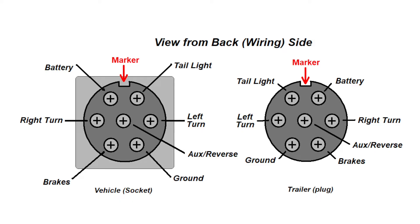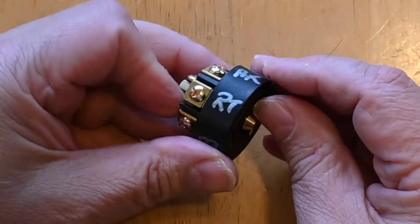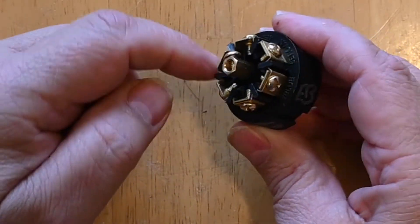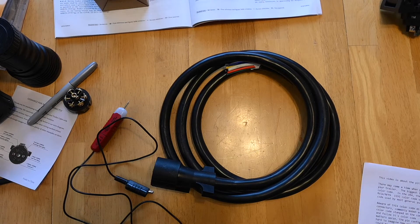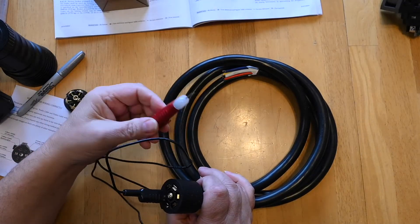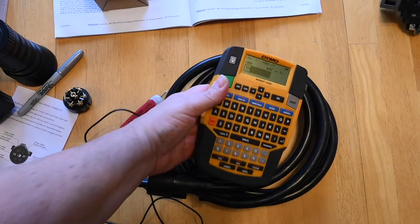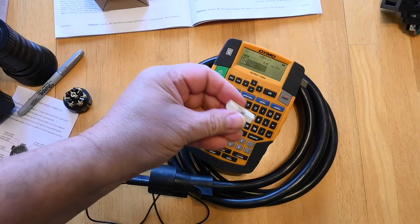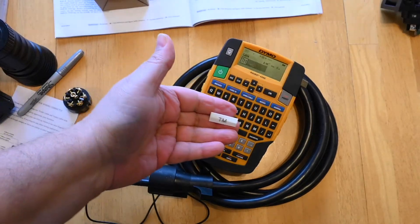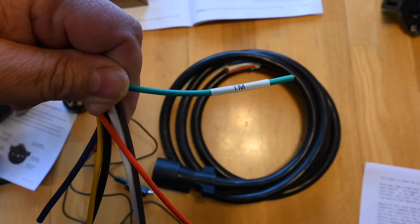If you've been a viewer of my videos, you know that I have a website that goes along with each video, and I have all these drawings that I'm showing in this video on that website. When I get ready to connect this to the wires, I'll know what the functions are. I disregard any of the lettering on the back of the connector and use the function of the wire rather than the color code. I know for instance this is the taillight marker, and with a little $6 continuity tester I verify it goes to the correct wire. I also like to take my label marker and print out a piece of heat shrink for each one of the wires, so I will always put the cables together using their function rather than color code.